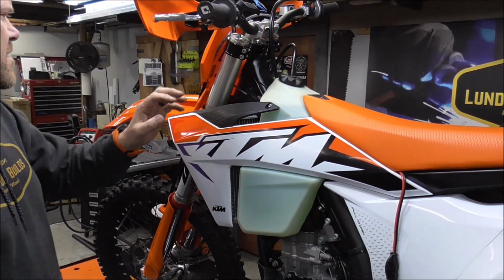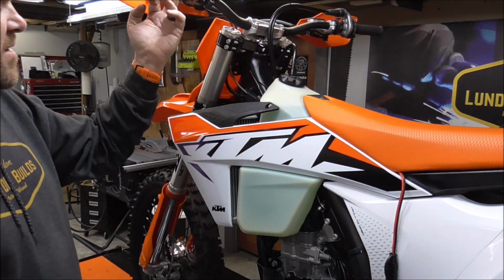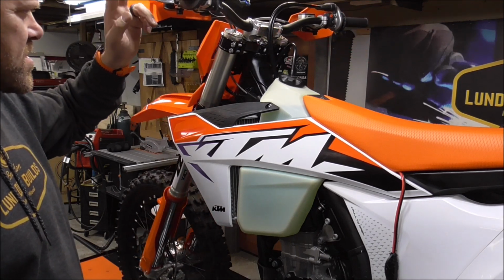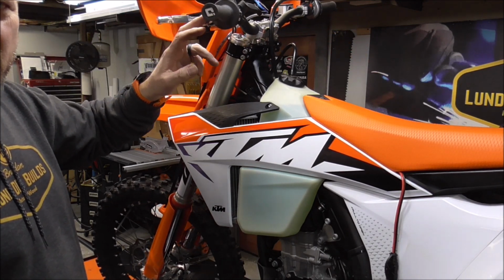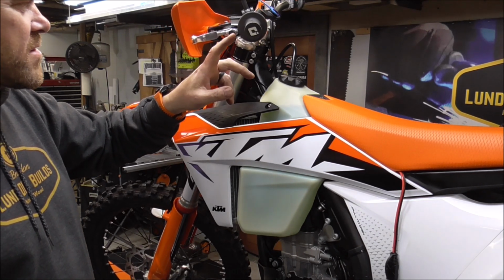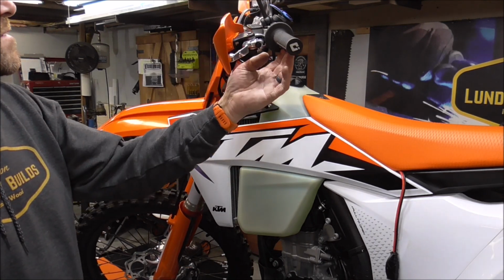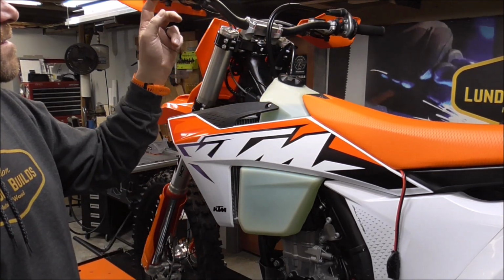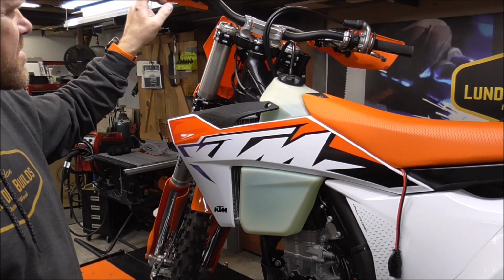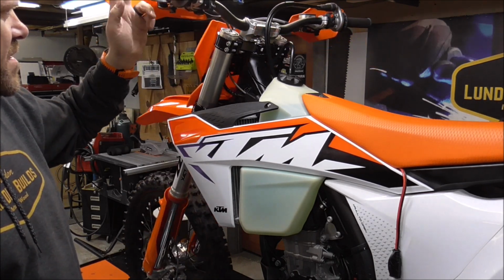And once you're done, make sure everything is just how you want it, and that it's got just the right tension. You don't want too much because it's going to steer heavy. But you can see just a little bit of pressure and these bars will kind of go on their own. There's no notchiness. And this is a brand new bike, so it's going to get a little bit looser over time. But you can see it's slowly turning by itself. But yeah, this feels really good.